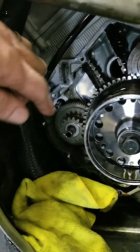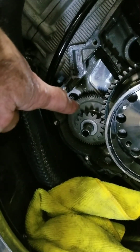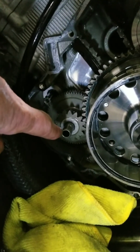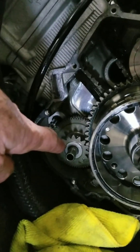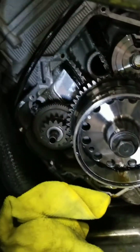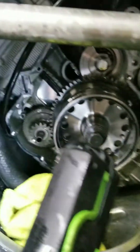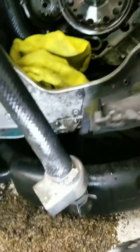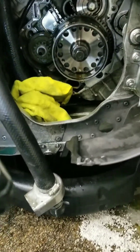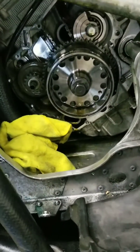Don't panic — this is the starter gear. That right there is the end of the starter itself that drives this gear, which drives the crankshaft to start. This pin just sits there, so when I pulled the cover off the pin fell out and the gear was cockeyed. It just took a couple of minutes to figure out what happened. I did a test putting it back on — just slide it into place. I had to disconnect and drain coolant because the coolant heater was too big to let the cover come out, so I had to pop the hose off to clear it.